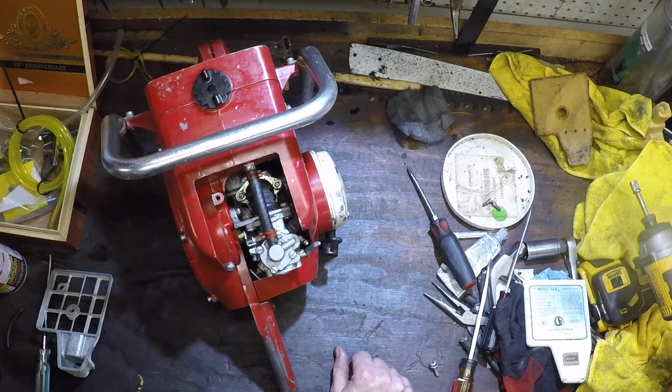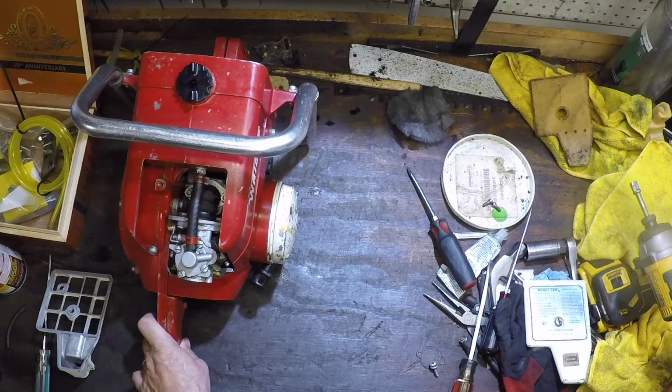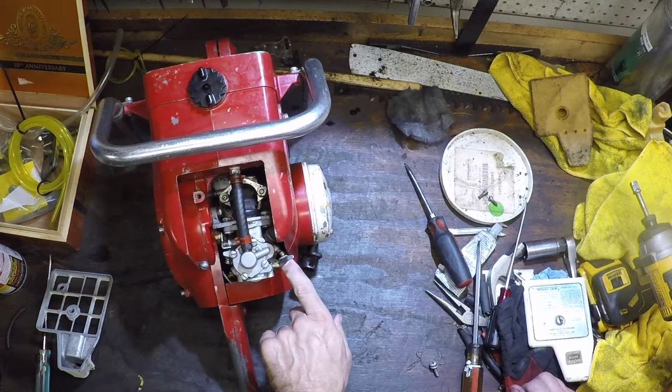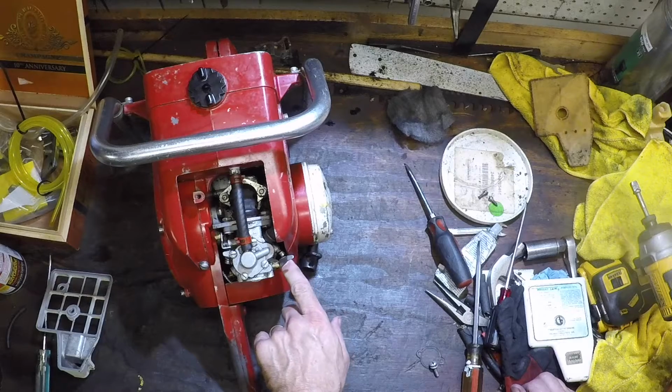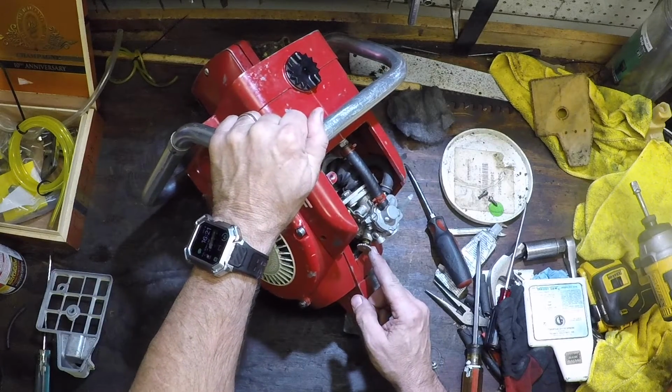And I'm adjusting it, and I guess the seals are right. I flipped it on its sides and up and down, and the idle didn't drop. It settled down. It took a little doing. Initially, it was pretty rich. I guess they must have tried to adjust all the settings. I think this is, I don't know, probably one and an eighth out. That seems to be where it's happiest. And you adjust the high side with this little wheel here.